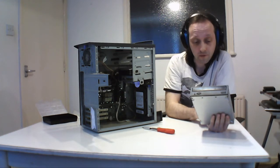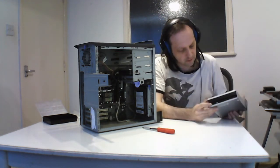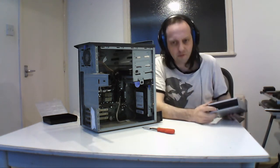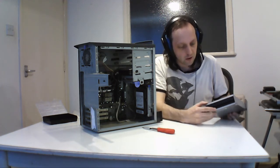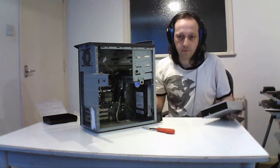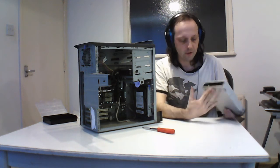Got the Nova as well. So yeah. On the back, there's some connectors. There's a digital DV thing. Never used that. Audio. There's a little jumper here. Now the jumper is for when you set this to whatever thing. So there's one marked CS, which is cable select. So that's what's saying about the colours. You put in the right one. SL is slave, and MA is master.